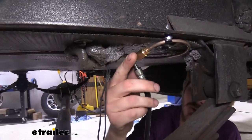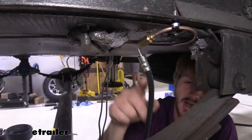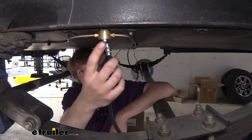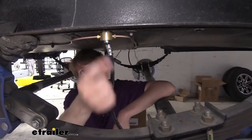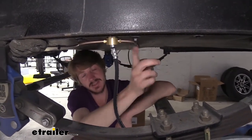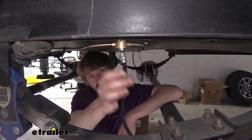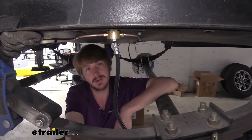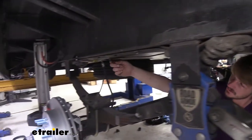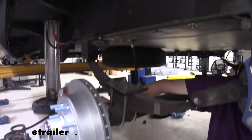On your short lines where they go to the other axle, you just have a regular one-to-one union — it connects our line to our brake hose and the hose then goes down to the caliper. Over here you can see our three-way union, where we again use the self-tapper to run it up into the I-beam, and I stacked a couple washers on this one as well. The medium-sized line in your kit runs across and connects here with a little 90-degree bend. The middle connection goes to our brake hose down to our caliper, and the third connection is the short line that goes to the axle at the back — and just like on the other side, it loops around to a single union that connects to our brake hose and goes down to our caliper.